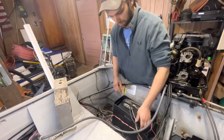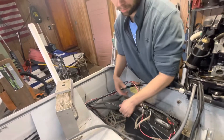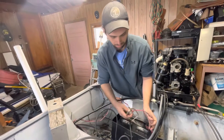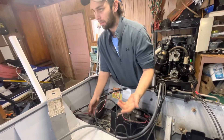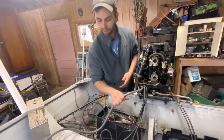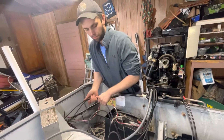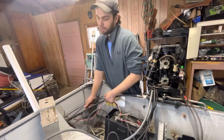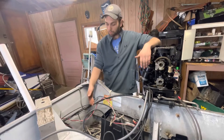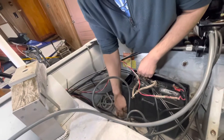Back here you've got the battery. Someone did a fantastic wiring job — everything is wired going straight to the battery with no fusible links or anything. We've got corroded terminals on the battery so we'll have to clean those for good connections. Nothing's fused, which is a safety hazard — something goes wrong and you can burn the boat down. We're trying to keep this on a budget but we want it to be safe. The battery's dead so I've got to charge it. The wood back here is getting soft, and with a 50-pound battery you don't want it to fall through.